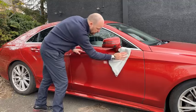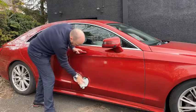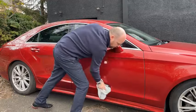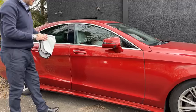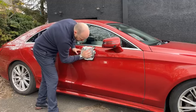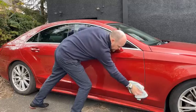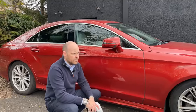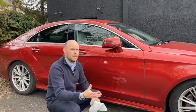If this wasn't a live video I would probably be leaving this about half an hour to 45 minutes, because it's still a little grabby on removal. If you're finding your wax is grabby on removal, it's probably not fully cured — just leave it another half hour and come back to it. The biggest thing I say about the luxury waxes is don't rush them. It's like anything that's really good quality — red wine, champagne, cars — they all take time.